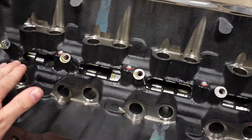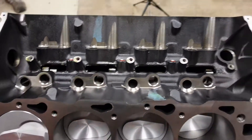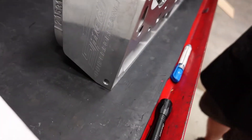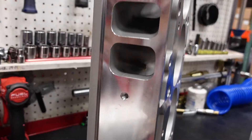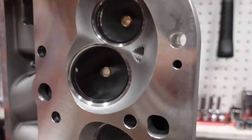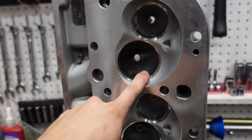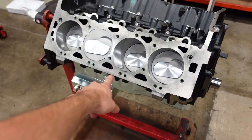To open the valves we have one of our Smetting camshafts. This cam is 253/263 duration at 50, and the cylinder heads we're going to run are our Smetting 360cc rectangle port head. They run a Manley dual spring, a 2.3 inch intake with a 1.88 exhaust. 2.3 inches — most small blocks are 2.02, your LS3 head is 2.165 — that's 2.3 because again we're feeding 540 cubic inches of air.